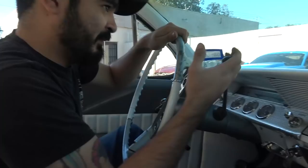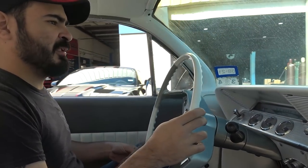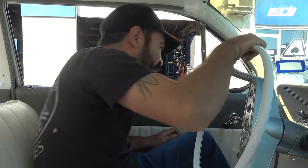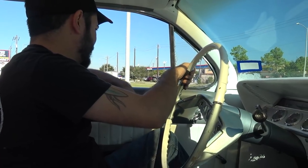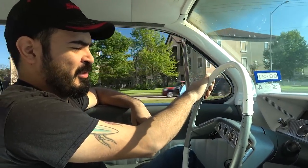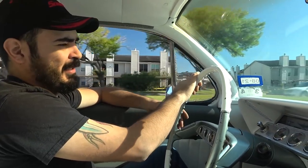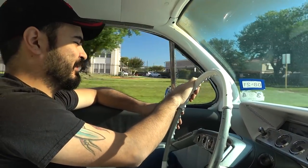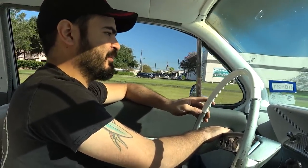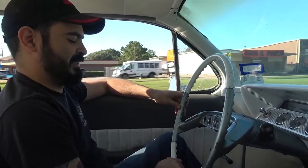So this car was dropped off a little while ago — needed a new gas tank and a couple little things. It had an inline pump, and those of you in the LS swap business know that inline pumps are terrible. We put a fuel tank in this thing with an in-tank pump to make it more reliable. Messed with the brakes a little bit. It also had an issue with no oil pressure — whatever idiot that worked on this thing hooked up a vacuum line to the crankcase, not helping with oil pressure control. Now it's got oil pressure. It wasn't starting because they left the cam sensor unplugged — just a bunch of crap. And they charged somebody money for this.